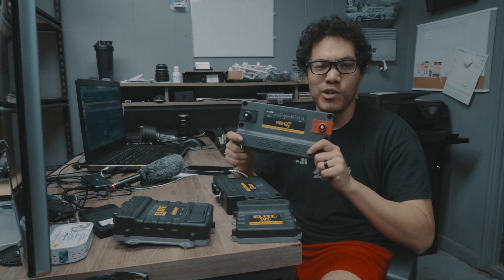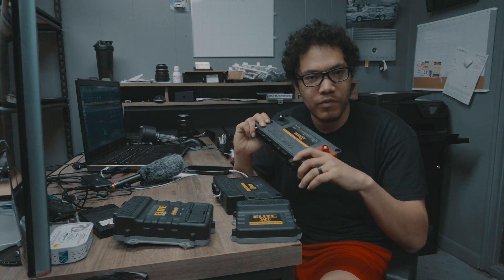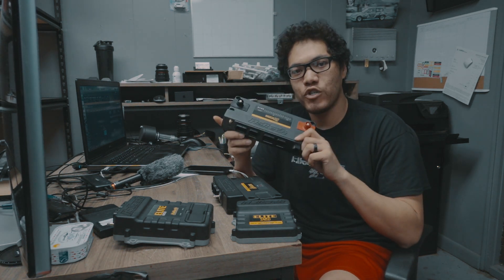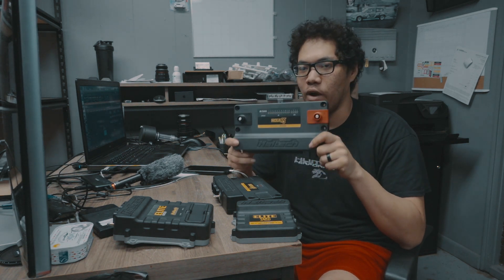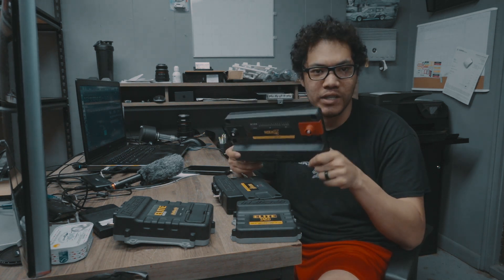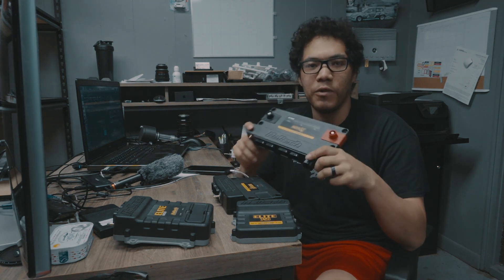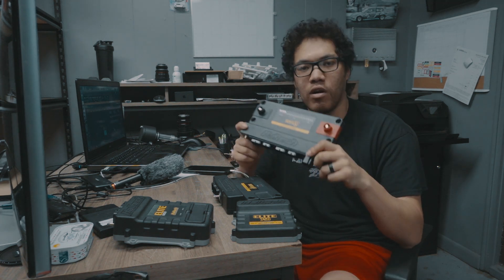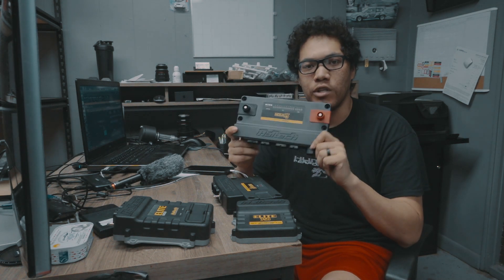With a regular fuse box, if a fuse blows you have to check each one individually to figure out which one it was. With the Nexus R5's smart fuse box, I can look on the computer, see which channel blew, and reset it through the ECU. I can also create strategies to power things up when needed, and PWM outputs. For example, if you're running a Davies Craig water pump, I can control the pump speed without buying an external controller. For a brushless pump like a Weldon 2345A, I can control the pump speed through the PDM, and soft-start fans to reduce the initial amperage spike.